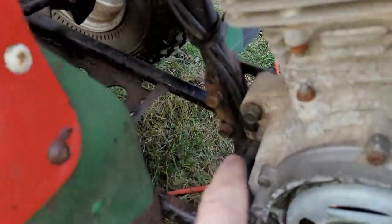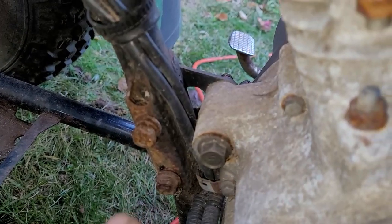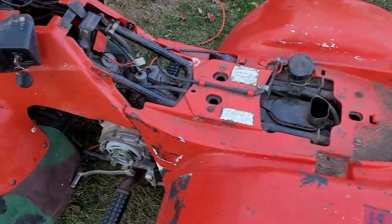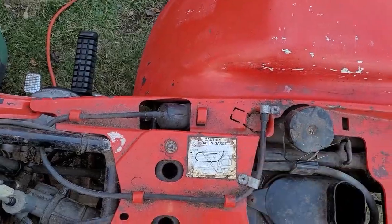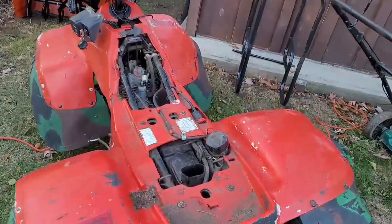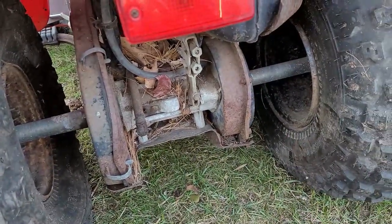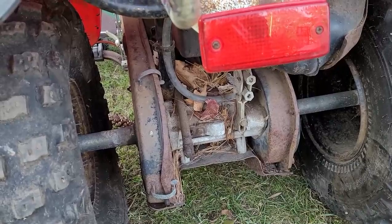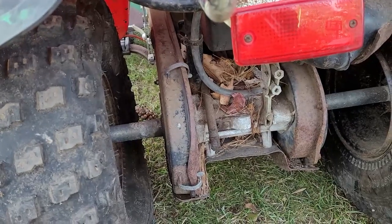At a quick glance in the front here, the bolts are rusted into the frame and it's missing one of the mounts. See the mount on the other side? It's supposed to have a triangle-shaped mount on this side as well. It's got the actual proper tank vent and cap, it's got the cover. I go to the back of the bike — those are a couple positives — and then I look down here and I can see the chain guard is all smashed in and the axle for the brakes is bent in on this side.